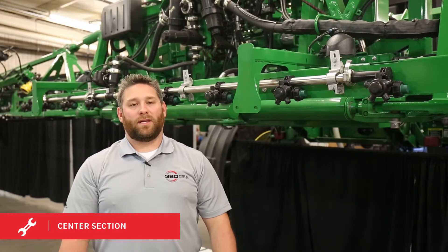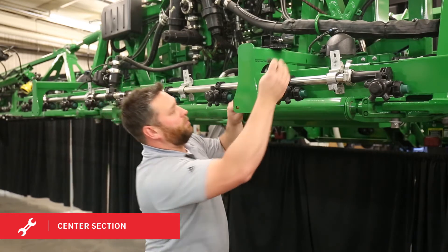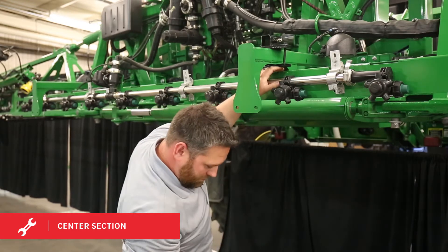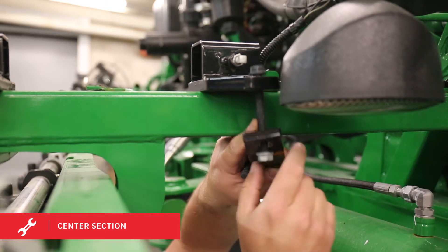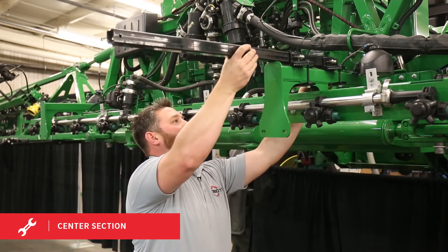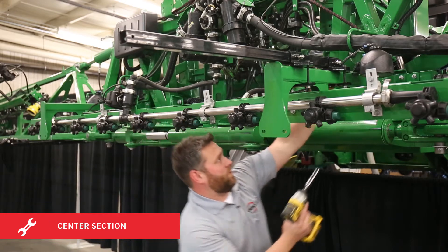We're going to move to the center section of this R-Series. We're going to start with our R-Series center section mount bracket — there are two of these, but we're going to start with the back one. Take our bracket, put our bolt down through on each side. We're going to take our 6-inch plate and then install our flange nuts. Repeat these steps for your second bracket also. Once you have your center section brackets on, then you're ready to slide in your 39-inch extension tube, just like you do on the primaries. Go ahead and put your stop bolt through the back, then tighten up your brackets.